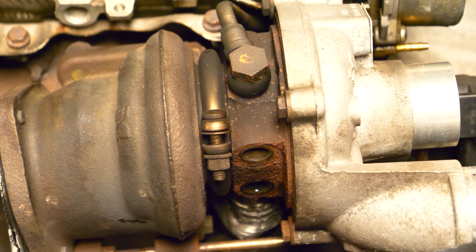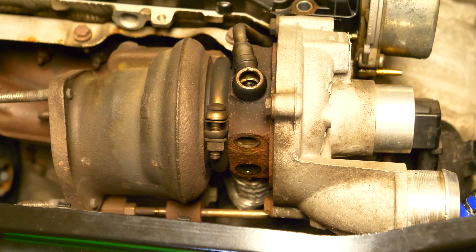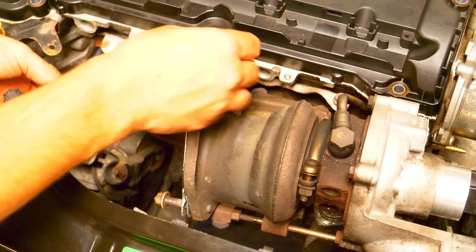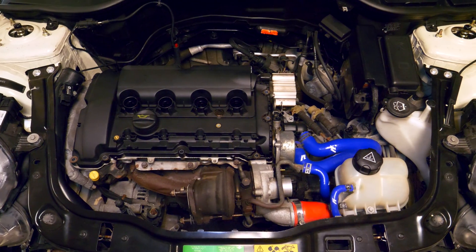With the oil feed line now disconnected at the top of the turbocharger it's time to remove the oil return line, found on the bottom side of the turbocharger, held in place by a 10 millimeter bolt. You're going to need a long extension in your 10 mil socket to push the line out of the way. We're going to be able to completely remove the turbocharger only after we disconnect the exhaust manifold from the head — that's going to be completing the last part for this video. So as you can tell, we started off with this and now at the end of this video we're finishing up with this. We were able to remove all of the cooling system, all the fuel stuff found on the backside of the motor, and we started to get access to the turbocharger. In the next video we're going to disconnect the turbo itself and remove the exhaust manifold.